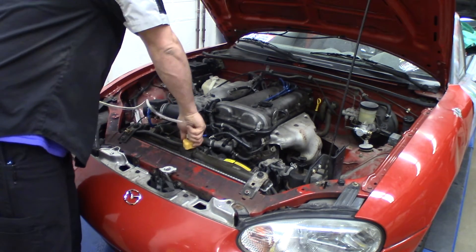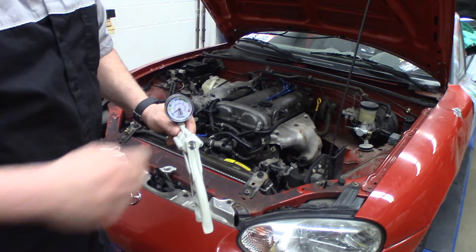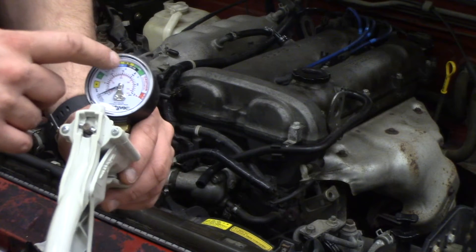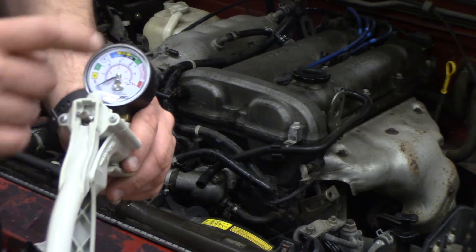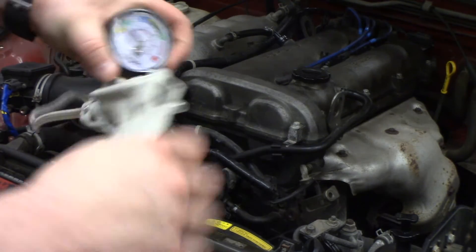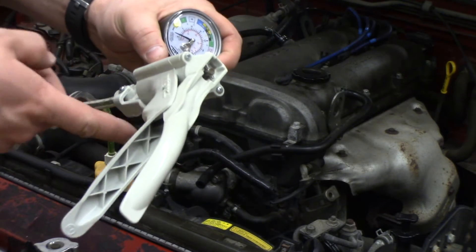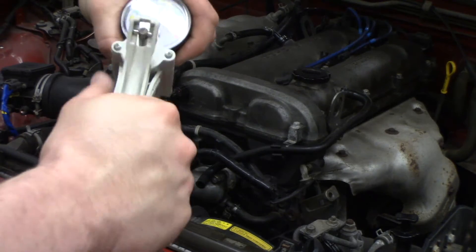Line up the spacing, turn until it stops, and now we're good. On our gauge we have pressure readings. This is a 16 psi cap, so 16 psi falls in the yellow range — there's actually a little yellow triangle we want to reach. On the underside of the pump there's a small tab that is the vacuum release; we don't want to touch that while pumping. Keep hands away from there and go ahead and pump this up.